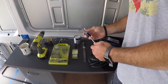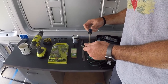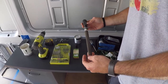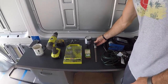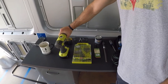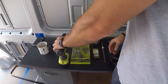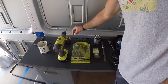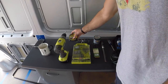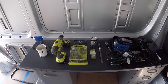For the window itself, you'll need a screwdriver. You could use a drill, but I'd rather not overtighten it, so hand tighten it. A raw metal filer to ensure that the raw metal is smoothed out and ready for paint — painting it, of course, to prevent rust. And then we'll have to drill a hole into the window to get our jigsaw blade in there. Safety goggles, of course — you don't want any metal shavings in your eyes. And measuring tape to make sure everything is aligned properly. Measure twice, measure three times, cut once.